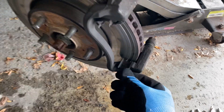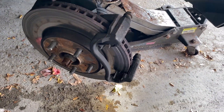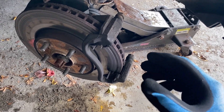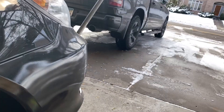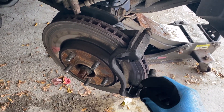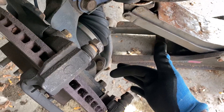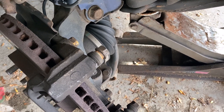At this point you could basically just remove the retainer clips, put the new ones in, slap your new pads on, and put everything back together if you're just doing a pad slap. But since we are doing rotors as well, we're going to remove the caliper bracket. The caliper mounting brackets are here and here — they're also 17 millimeter.